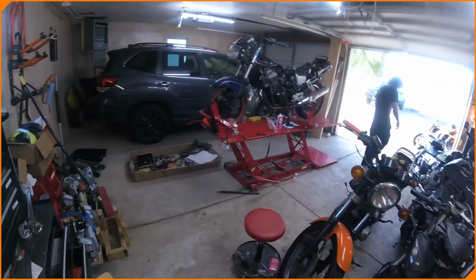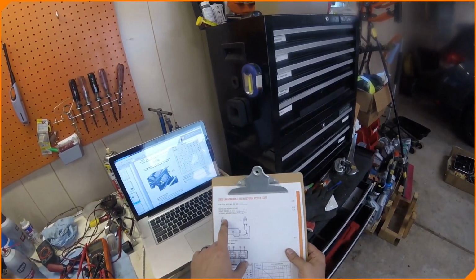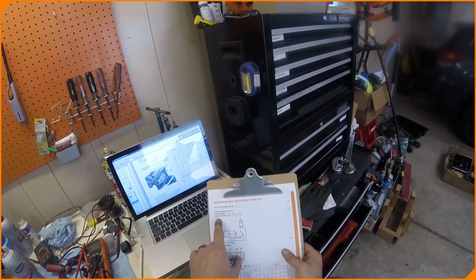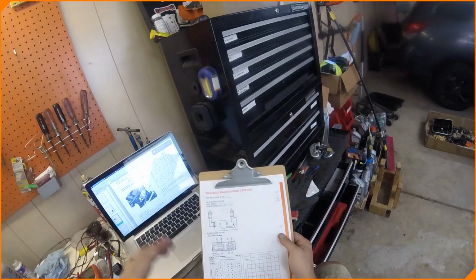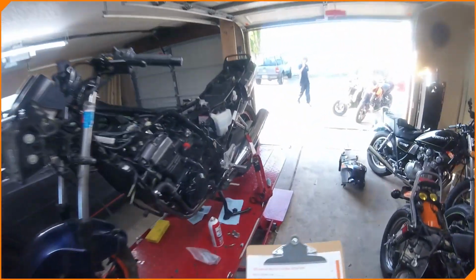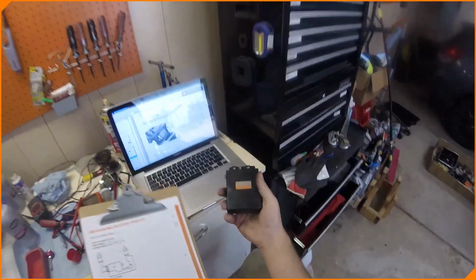All right, back with the Ninja 250 out here, and I went through the electrical system and did all the tests. Pickup coil resistance, 116, which is between the 100 and the 150. Ignition coil winding resistances, primaries 3 and 3, between the 2.1 and the 3. Secondary windings 14.46 and 14.41, between 10 and 16. And then we get down to the CDI, the beautiful CDI, which is over here. Connecting any of these terminals, they all read infinite. So I think we found our problem.